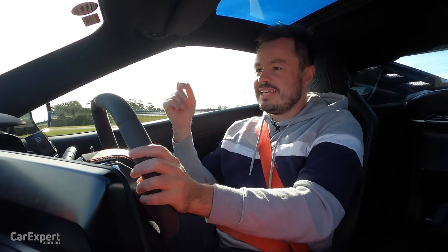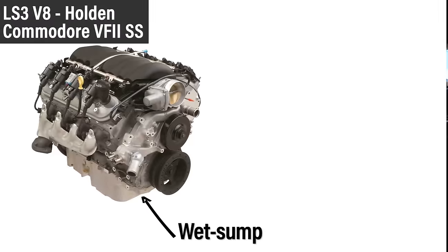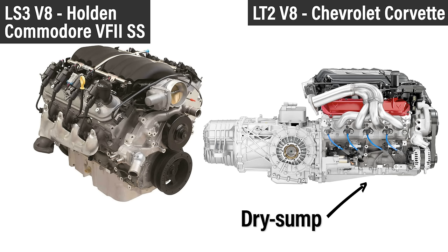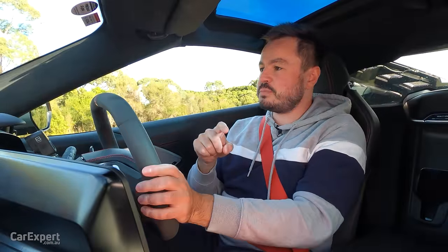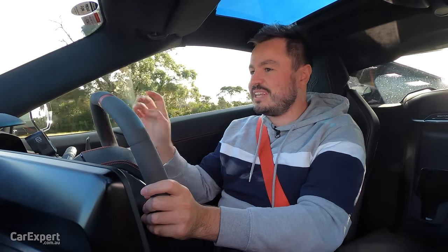One of the things that makes this engine so special is where they've been able to place it inside the car. Yes, it's mid-engine, but it sits really low — it has a low centre of gravity, thanks partly to a dry sump. In a typical car, you have a sump at the bottom that collects oil and it gets sucked back up to the top of the engine. This has a dry sump — no big reservoir of oil at the bottom — meaning you can sit the engine lower to the ground. It uses three scavenge pumps to recirculate oil. The advantages include weight saving and performance benefits: no issues during hard cornering where you'd normally starve the engine of oil and cause heat and friction. It just shows the lengths they've gone to, even in the entry-level model.